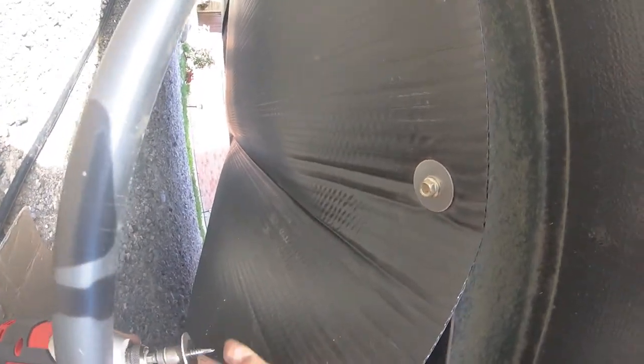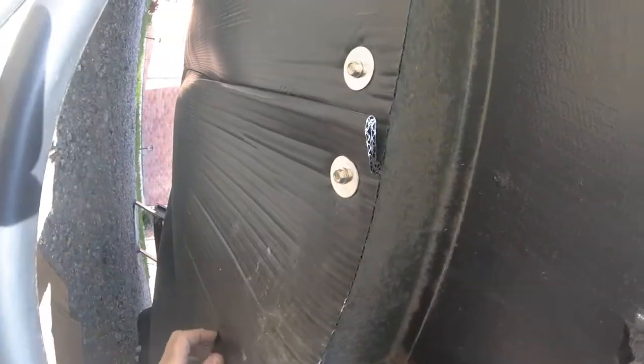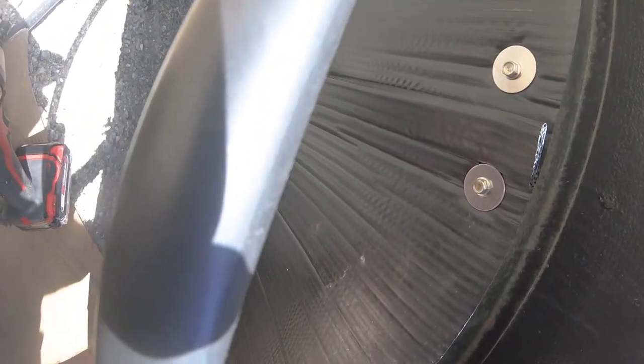Like this here, you can see how I did that, and then this is going to go back, and then I'll just work my way back. It's wider than the camper, so I've got room. Of course some of this is pretty crooked, and the way it hangs down is kind of cheesy, but I'll put one right here. It'll work out one way or another. Then I come back and trim it. All this under here I sprayed with Rust-Oleum rust preventive, which stops the oxidation and the rust, so that's good.